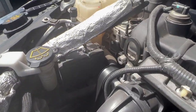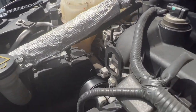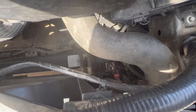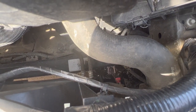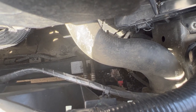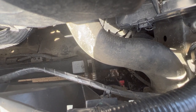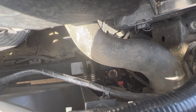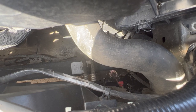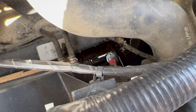You can see the reservoir going down. So there you have it — there's no need to get underneath the car; you can access the drain plug from the top right here. Now we just have to wait for that to drain all the way. After that, go ahead and tighten the drain plug back on.